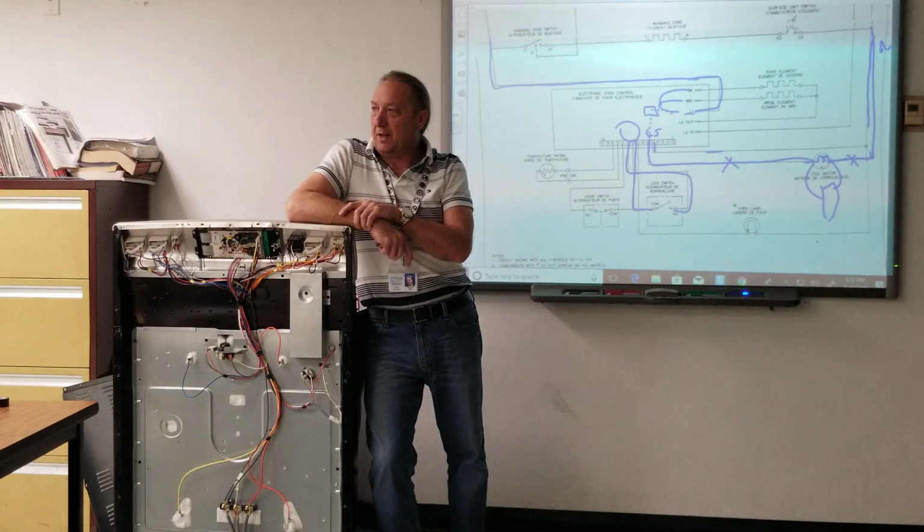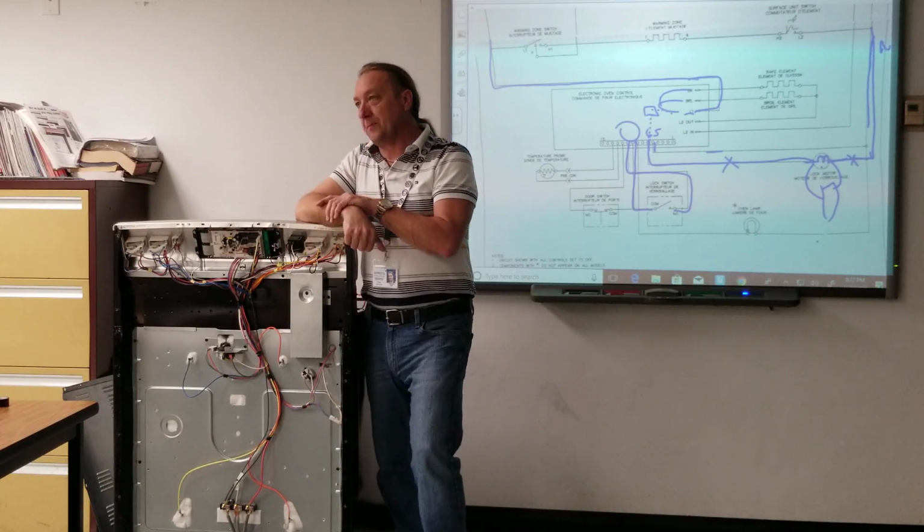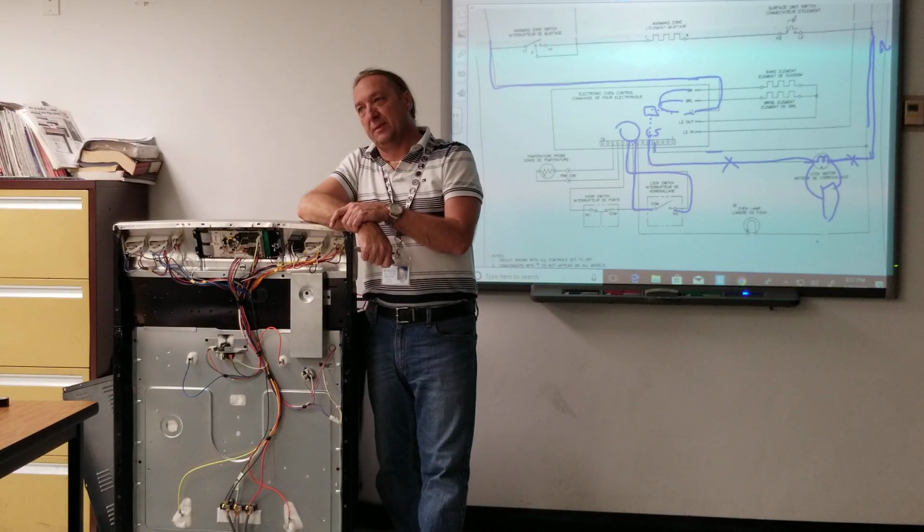How many of you guys found that in the competition? Y'all did? You find it, Jervinsky? No? You got it, Fausto? I wanted to point out here though, I didn't check for voltage specifically into the motor itself, but I went ahead and ohmed it out and I noticed that it was an open line.